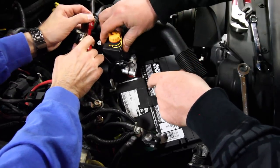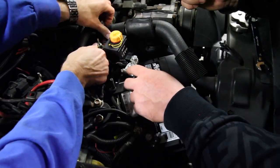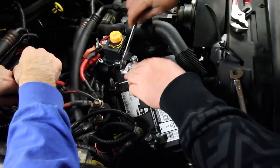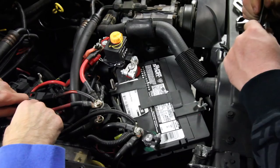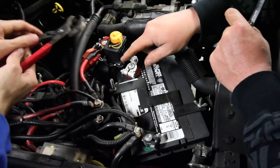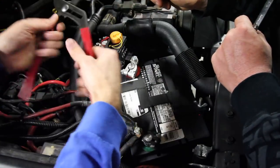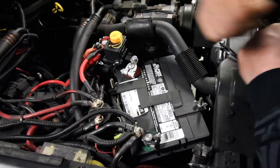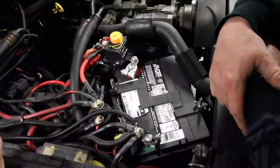So we tighten that up. That's tight. Because that's about as simple as it gets. Now, this is a relay that's going to go clunk — it needs a ground. So what we're going to do is take this ground wire. Now that's tight. We'll take this off and put it to a ground wherever we want to, and that's about it. Then we'll be able to test it.